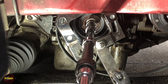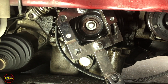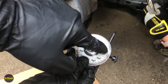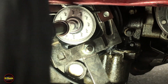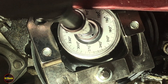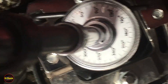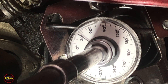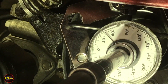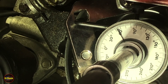Using a digital caliper, I'm measuring the space between that point on the block and the pulley — confirming 5.5 millimeters just like the service manual indicated. Torquing to 110 foot pounds first, then putting the angle gauge on there and running it an additional 60 degrees.